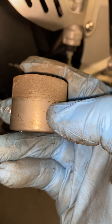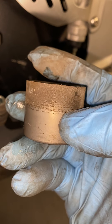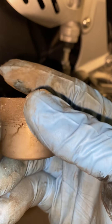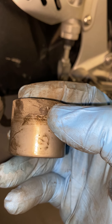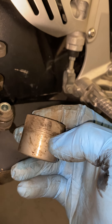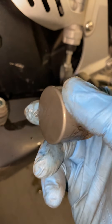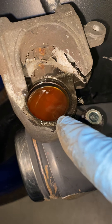This is really important for the health of the seals. When you change your brakes and retract this piston to fit your pads so it fits over the rotors — yeah, it'll work — but these dust grooves won't be very nice to the seals, especially the dust seal. I wouldn't really recommend sandpaper; the best thing to use is a brown or burgundy scotch pad. Just rub it back and forth, make it nice and smooth, and be careful not to take the coating off.